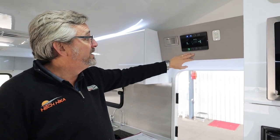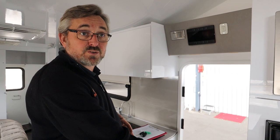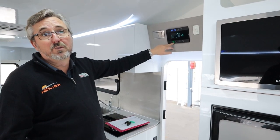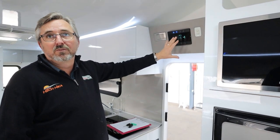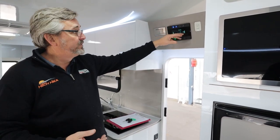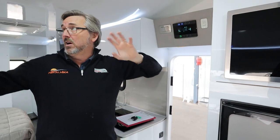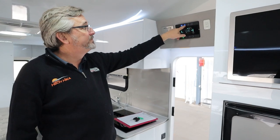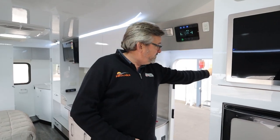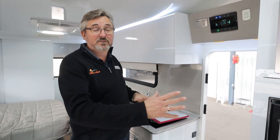This is the control panel you're going to be playing with in the back half. This is your power button — when it's time to travel you'll turn that off, but your fridge will stay running. Jump in the back, push it and it'll power everything up — it'll come up green, which is what we want to see. If it's red, the panel is going to tell you something's wrong: one of your batteries might be running flat, either the cab or house battery; your water tank might be getting empty or full. Across the top switches, the one that says 12 volt is effectively your lights, that one's your water pump, that one is your outside light for the porch step, and that one is the dimmer for this. Across the bottom we've got battery info showing your driving battery and back battery are fully charged, and water supply showing 80% fresh and 30% grey.